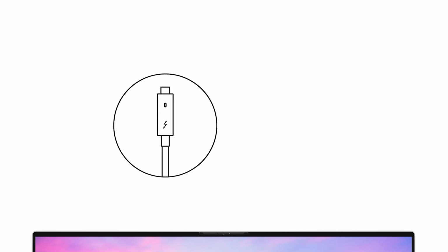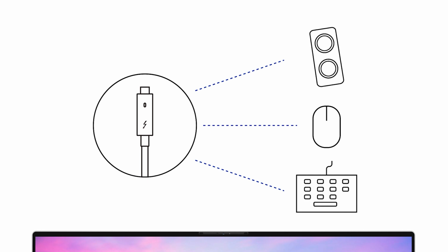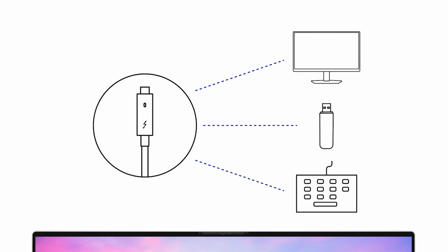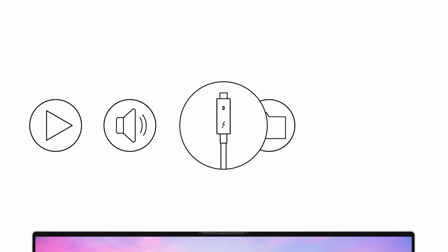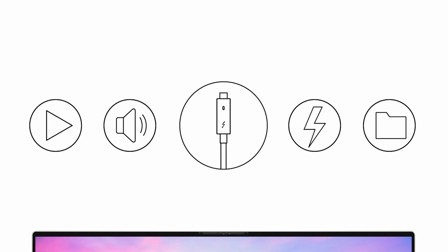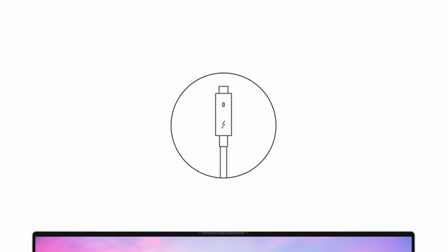Thunderbolt docking stations allow several devices to connect to the laptop using a USB Type-C cable. This extends the traditional USB capabilities of native multiple display video, audio, and data, along with charging power delivery through a single USB-C cable. The connector is reversible, so there's no guessing the orientation when connecting.